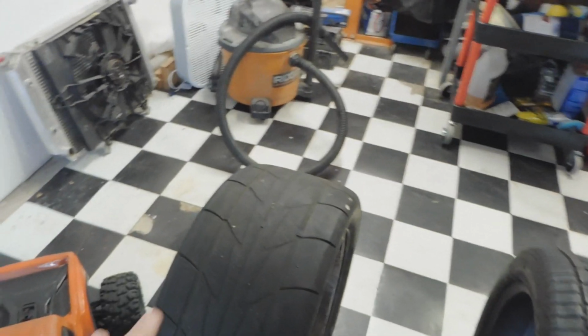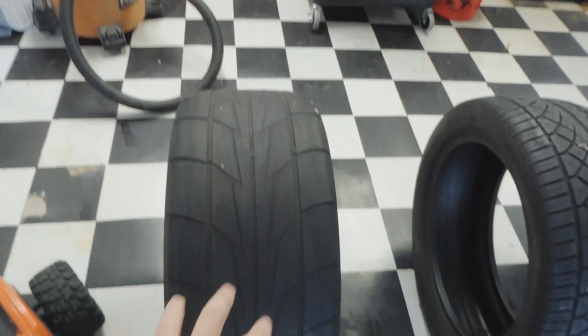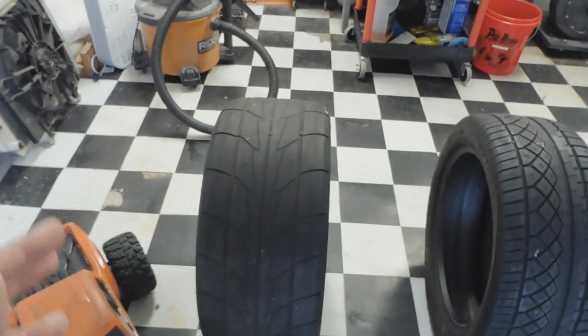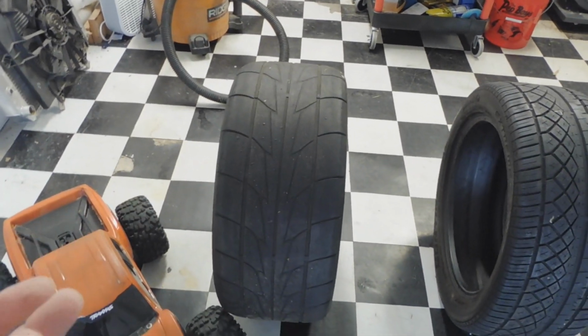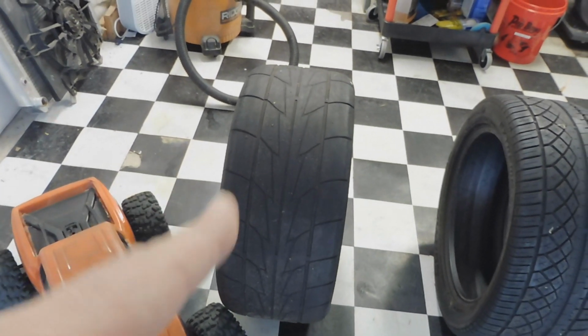This tire, somewhat people gamble a little bit with because you can see there's a lot of tread design going on here. There is area for water to escape. I still don't recommend it. Compound's different and it's just not designed or tested in the rain, unlike these other tires here. So it's not something I would recommend because you probably have a pretty expensive car, including your life. No big deal. So I wouldn't recommend that people do gamble with this.